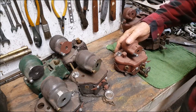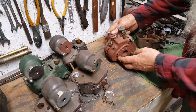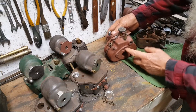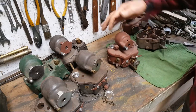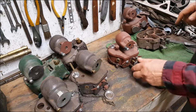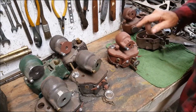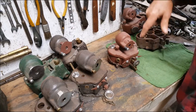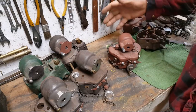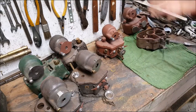If you have one of these engines and you're not going to run kerosene, it's advisable when you make that gasket to go on here — do not cut the hole in it. If you're going to run kerosene then you would have a hole right here, and this is for water. If you're running kerosene from the tank then you would inject water for better combustion and cleaning. But if you're running gasoline from the tank you would only use this one circuit and both of these will be closed off. For the reason for the water, just look it up.